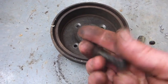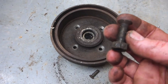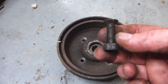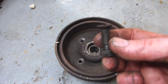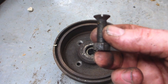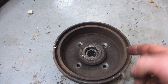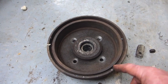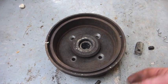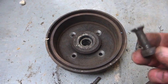These screws are British Standard Fine. But at some point the screws on my digger were changed to Unified National Fine — UNF. Now British Standard bolts — BSW, BS Whitworth, British Standard Fine — and in fact metric — have a countersink angle of 90 degrees. On Unified it's 82 degrees. So if you fit a unified bolt in a hole countersunk for a BS bolt, or vice versa, they won't do up properly — they'll probably deform, possibly break, and it won't end well. This is not an easy thing to get apart. If you do replace these bolts, just be conscious and ask yourself what countersinks are in there now versus what bolts you're putting in.